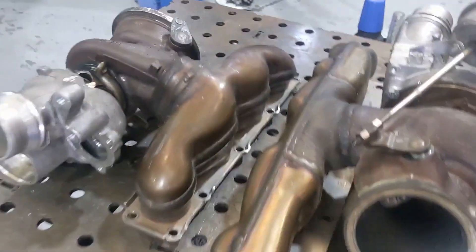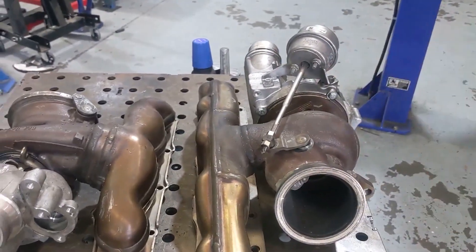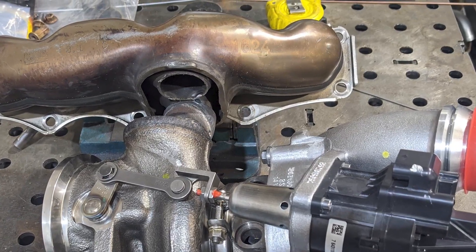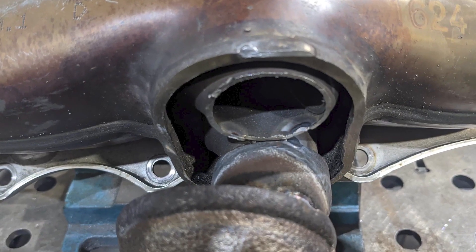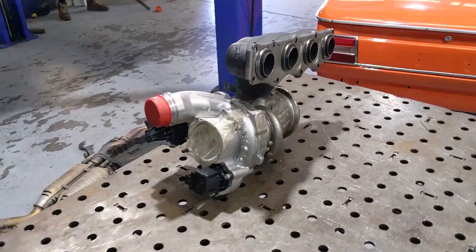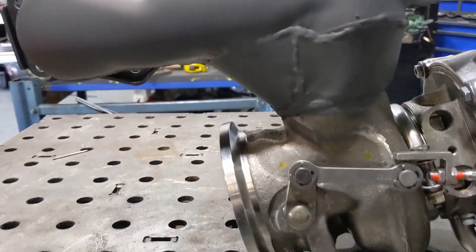The N55 one is quite round. The N55 turbo was found in the late E-series chassis and moved over into the newer F-series. The difference being that the F-series turbos were an electronic wastegate unit with bigger compressor housings and bigger exhaust wheels, making it a great candidate for a high flow upgrade, especially when moved onto a smaller four-cylinder two-litre engine. To allow the N55 turbo to work with our setup, we needed to cut the four-cylinder exhaust manifold off the turbo and adapt it to the N55 core. There are two internal pipes designed to allow for fast spool due to the twin scroll design, allowing the turbo to come on boost fast and efficiently. Once the manifold's been grafted internally, we then need to add back all the heat shielding and secondary structure to the exhaust manifold.